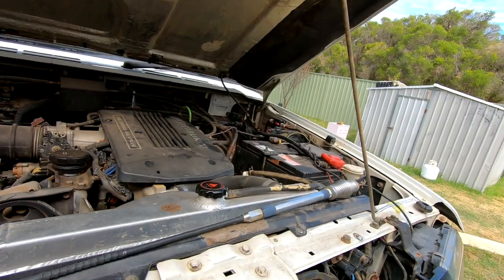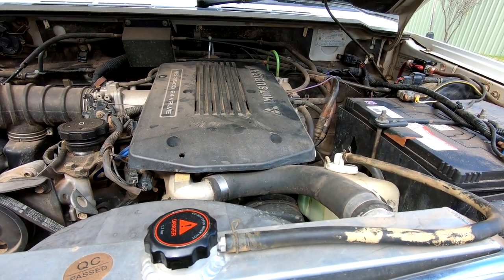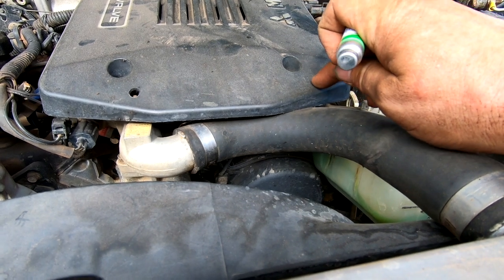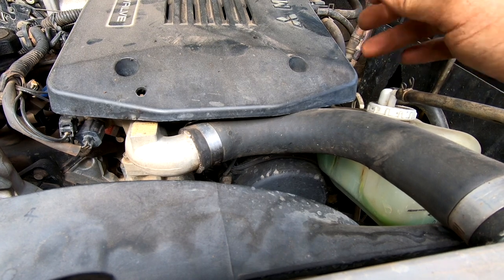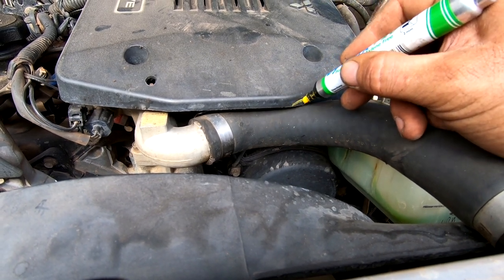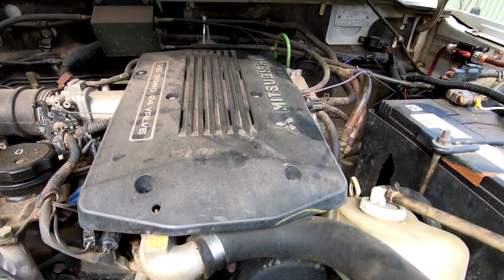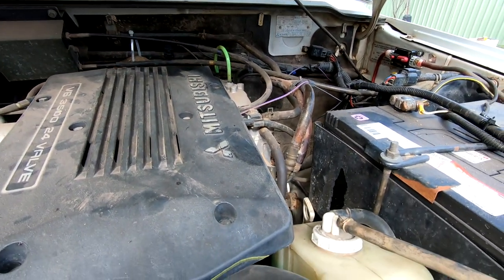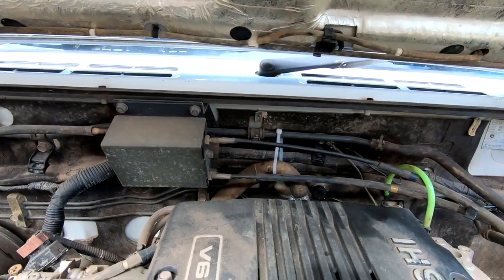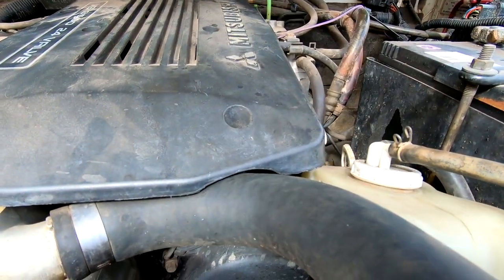One last thing — because the engine is lower and I'm not lowering the radiator, the top hose is touching on this engine cover. Over time that could rub through and damage the hose, so I can either take this off altogether or let's keep it neat and just notch a section out of there to stop it from rubbing. Everything else in the engine bay was fine. I've got that air con wire to sort, and the heater hoses are bypassed and cable tied out of the way so not an issue. Look at that — looks like a factory job.